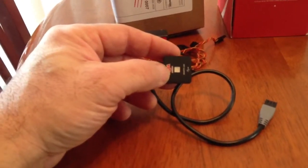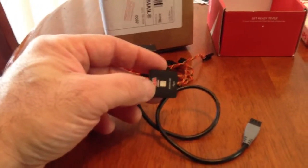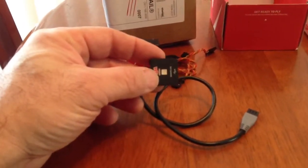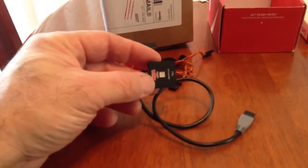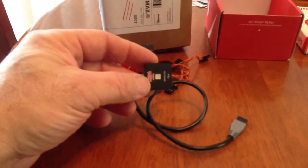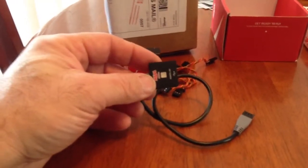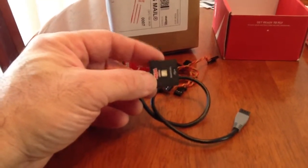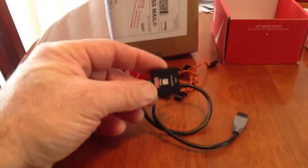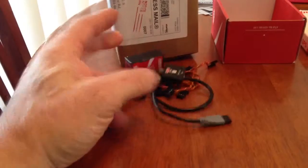It also has different codes that will flash to tell you different things going on. It's got a battery indicator — when this thing starts rapidly flashing red, that means your batteries are low and it's time to land. You can set all that up through the program to specific cell voltages in your LiPos. When the cell voltages drop to a certain point, it will start flashing yellow first as a warning, then it will start flashing rapidly red. When it starts flashing rapidly red, bring it in — otherwise it's going to land by itself wherever it's at.